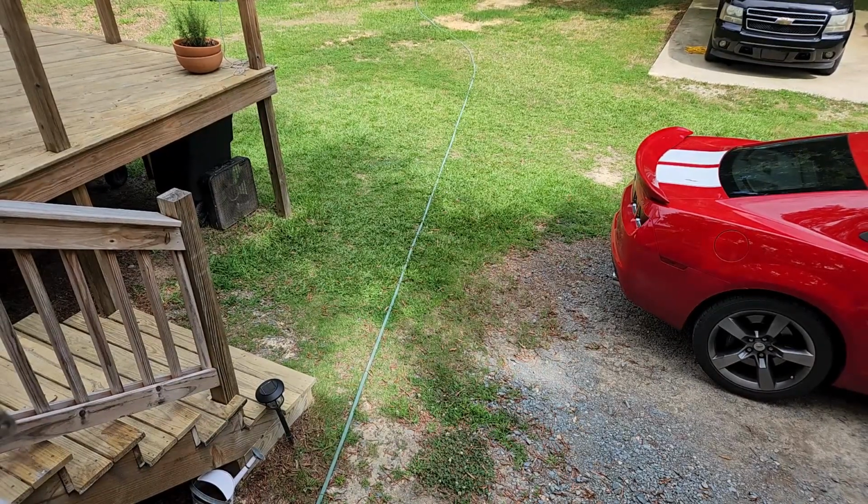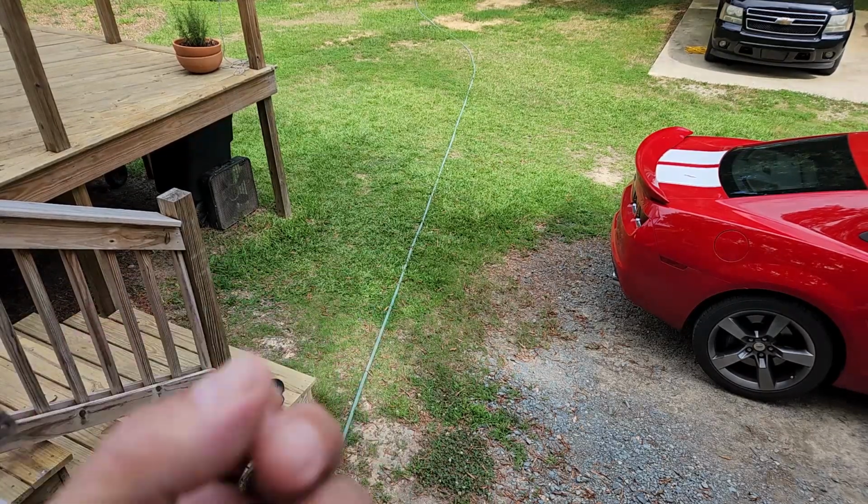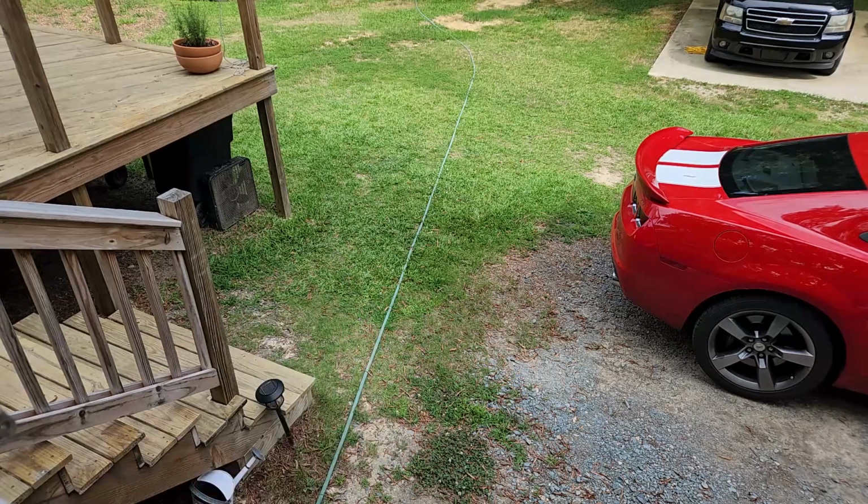I wasn't happy with the Auto-Borne sealer from Createx, the white. Whenever I would spray it, it would kind of bubble up. It was like it wasn't mixed good, no matter how good I mixed it. You're not supposed to agitate their paints long, but I would mix it anywhere from 5 to 10 seconds up to 20 or 30 seconds, and that was just way too long.